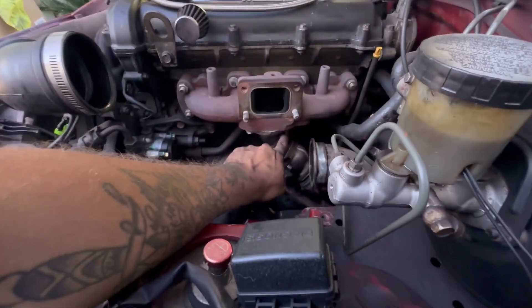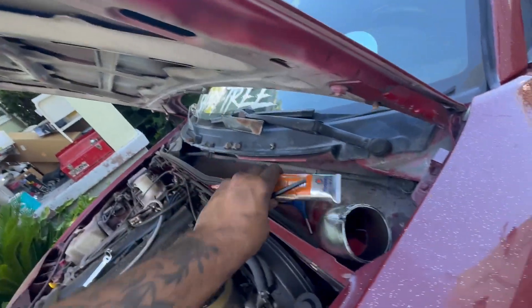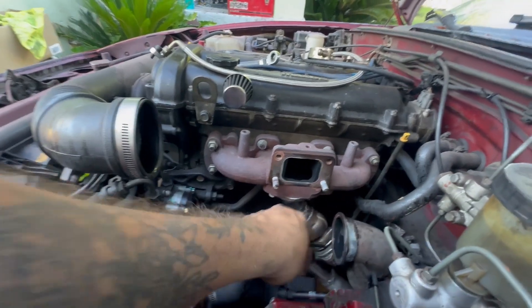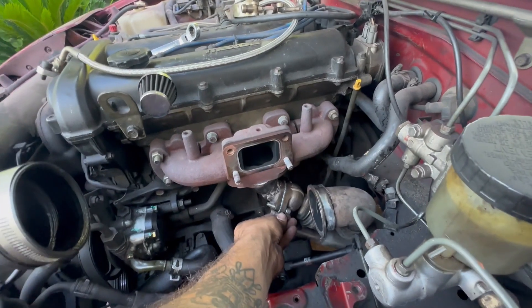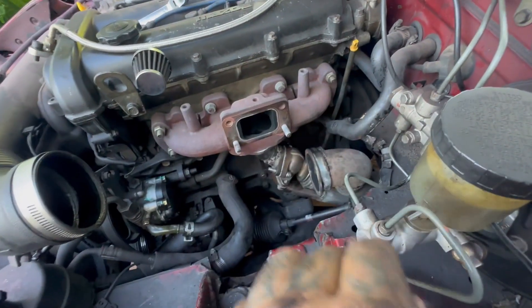So I guess it's a good bolt jack. Update guys — I'm kind of struggling, but it's worth it. So I tightened this bolt up, which is the same as this side, to the exhaust manifold. I went to AutoZone, got some of this exhaust gasket maker, and I actually put it on the thread, so hopefully it helps. I had already ordered these longer wastegate bolts because my wastegate keeps backing out — these kept falling off. So I ordered these long ones. This last time it didn't fall out even without it. I put a gasket in it and then these long ones, so I'm going to put a nut on this side and same on the back side, but right now I'm kind of struggling tightening up the back side. It's almost there, I just need to tighten it.